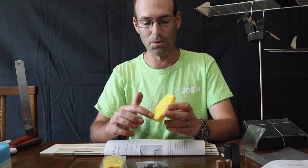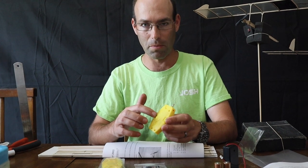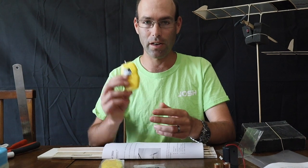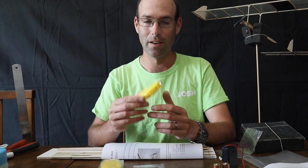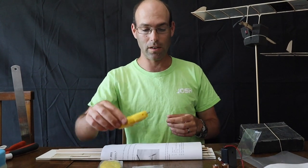There's going to be a terminal shorted out. Do not put a battery in that bay or you will burn up that battery, which is a kind of unsafe condition to say the least, and it may make your charger stop working. If you plug a battery into that bay, we do not cover the failure of the component.